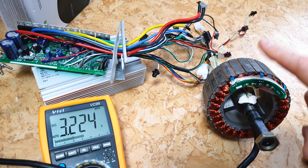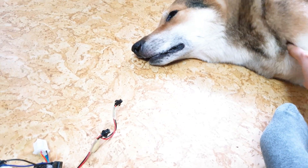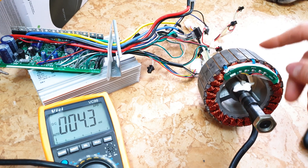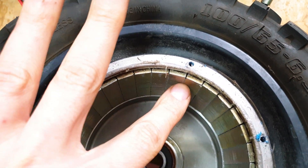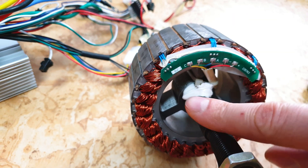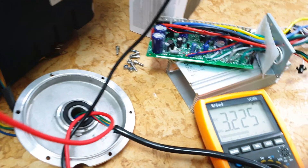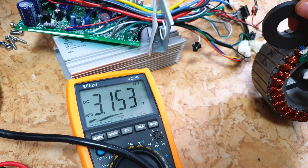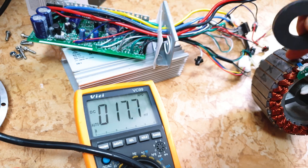You don't need to open the motor to check it - when you rotate the wheel, the magnetic field will fluctuate because inside the shell we've got magnets alternating north-south. Now let's check sensor C - the yellow wire. We've got 3.2 volts, and we've got 0 volts - so this one is also working. So this one small sensor simply doesn't work, and I shouldn't have ordered a new controller, because this simple hall sensor costs maybe 1 dollar or less.